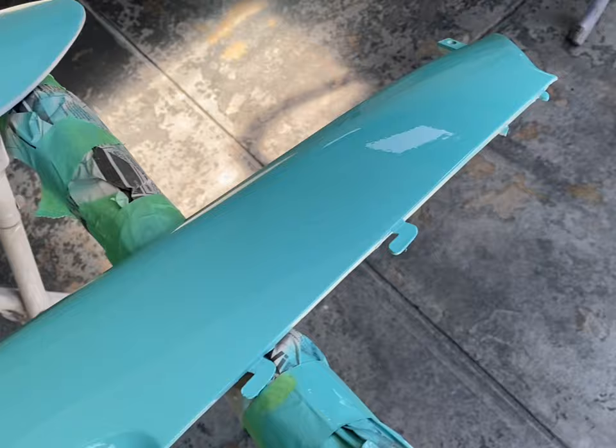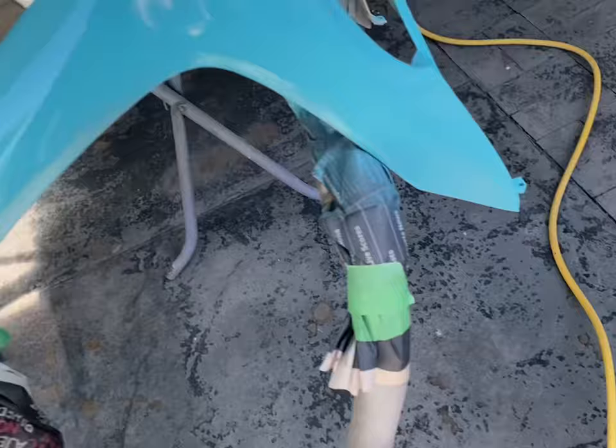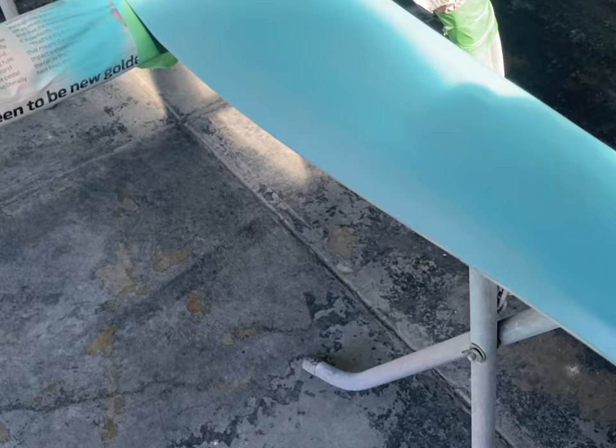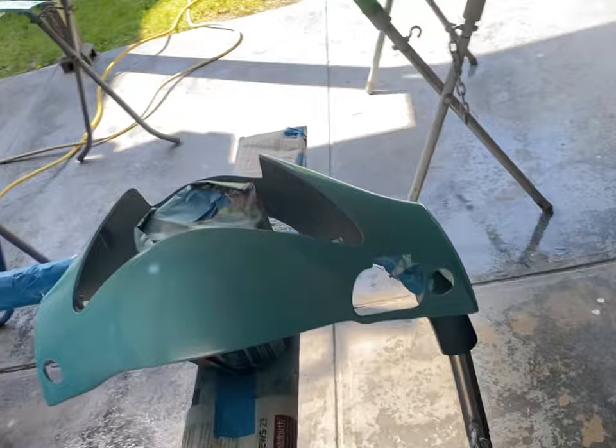And you can see there's little bits there where I haven't got coverage, which is fine because that'll get picked up in the second and third coat. And not a full gloss yet because of how light the coat is, like along that edge there. You can see it's almost see-through iridescent, and hasn't got into all the little holes and things like that until we get a bit thicker and more coats on. But you don't want to go too thick on the first coat because you risk it not sticking properly, getting runs, etc. So now we just wait for this to flash off,